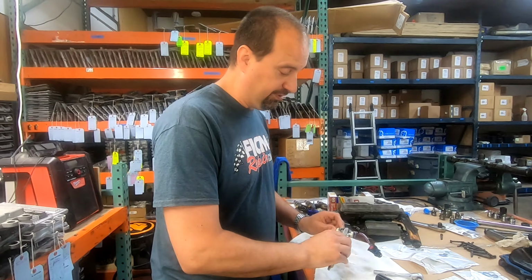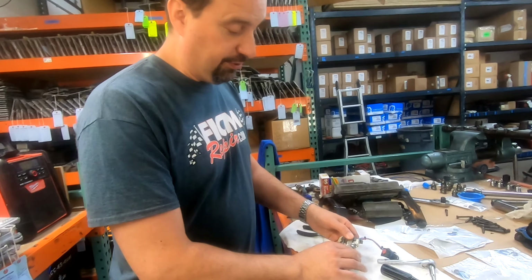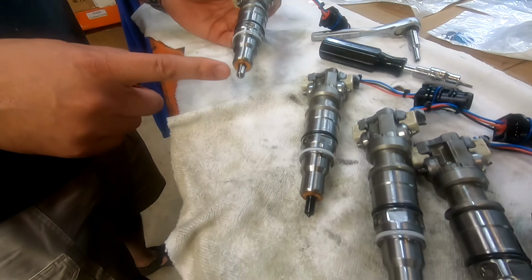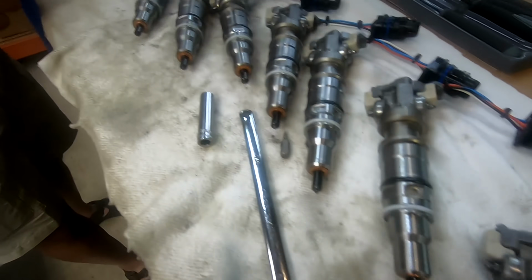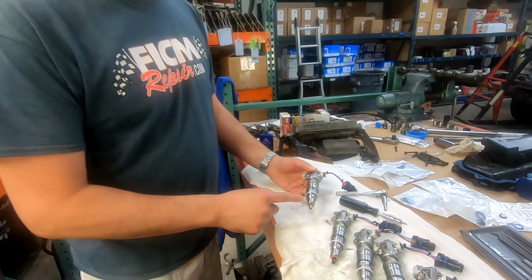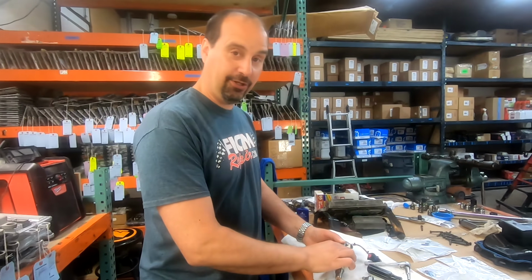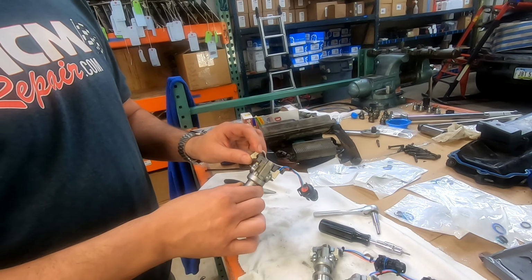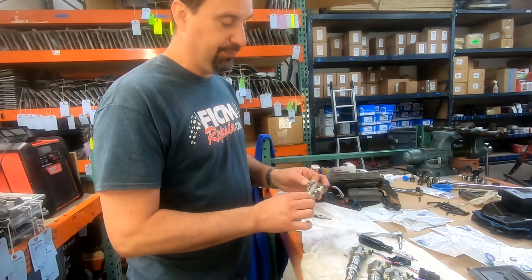What you could have noticed if you were looking at the original pan, maybe you noticed this, maybe you didn't, is that this injector tip looks like it's never been fired. All the rest of these are dark. This one here is not dark. This puppy never sprayed fuel, not ever. And it's like, I wonder why that is. Could it be that the installer, during the installation, shocker, actually broke this? I think so.